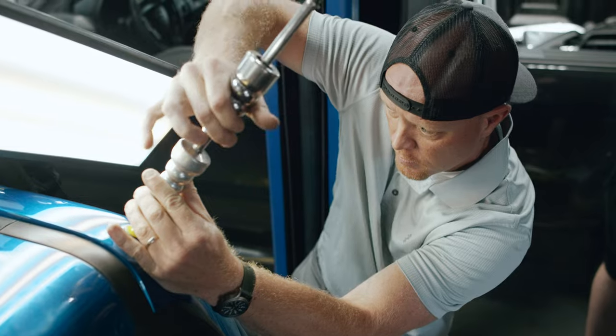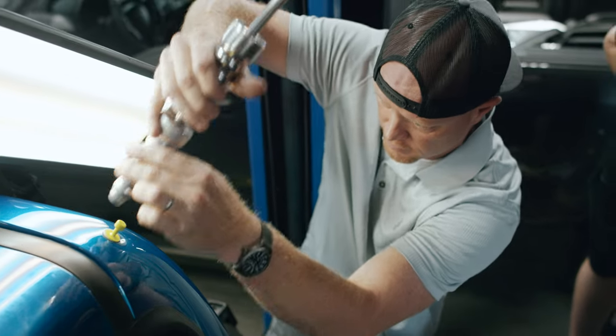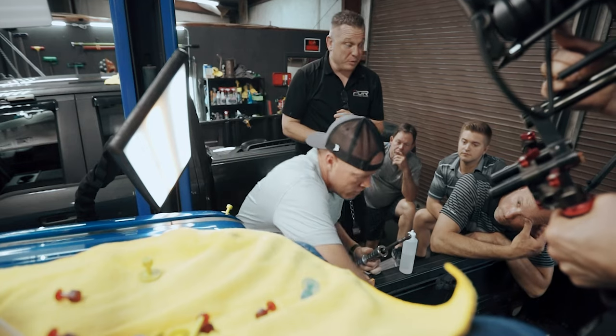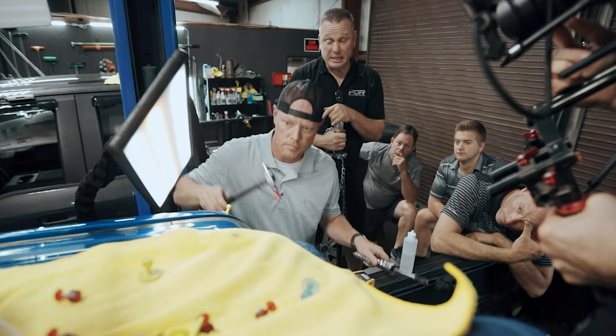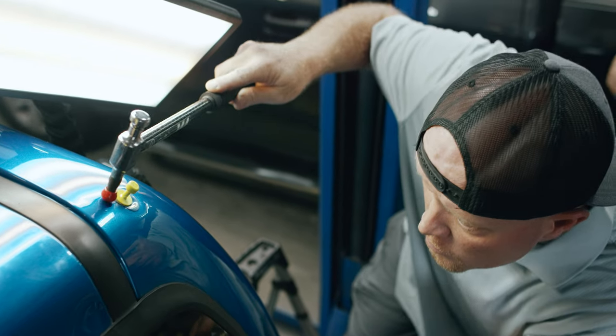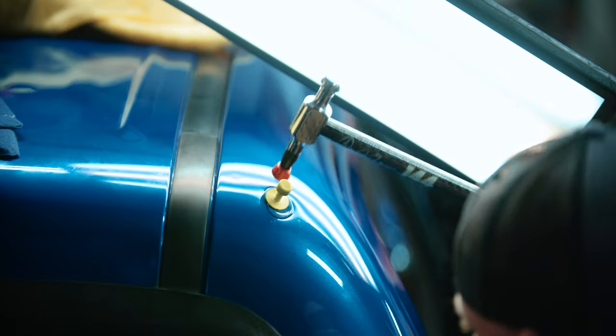Yep. Okay. Got it. Now, as you brought it up, what you wanna do now is work that crown. So relieve that pressure that just tightened up, and then you're gonna end up going back to it. All right, a bigger hammer.